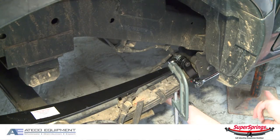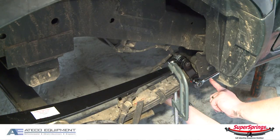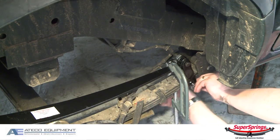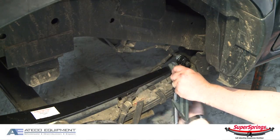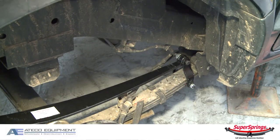Now that you've got it all together and you're doing it up, make sure you only adjust the bottom part of the shackle — not the top section — because this needs to remain loose so that you've got the pivot angle happening. Now that's hanging loose there, we're just going to back off the G-clamp and you'll see that it'll suddenly start to pick up the load. Now we've only got one side on it — we'll go to the other end now.